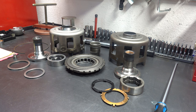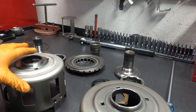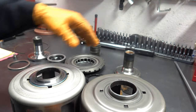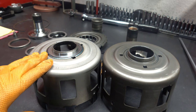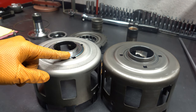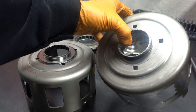I'll walk through the components on the bench, take you through what the differences are, and then go ahead and actually install the shell into the transmission — in this case, it's an early 4L60E. When you compare the two visually, you can readily see a significant difference in the area of the neck splines between the Sonic shell and the factory shell.